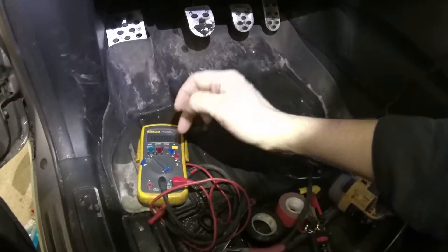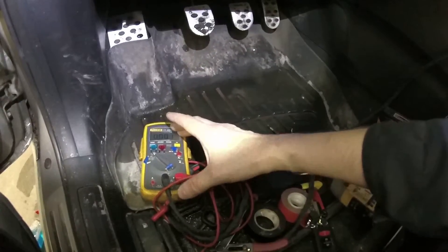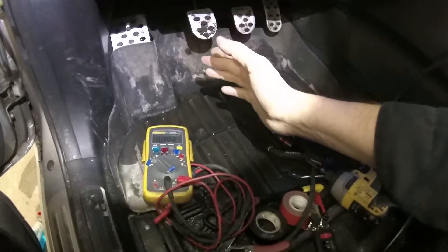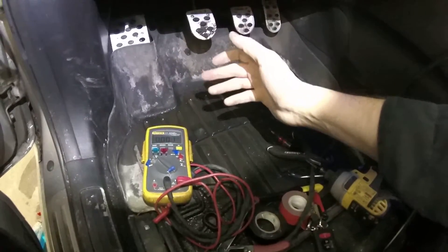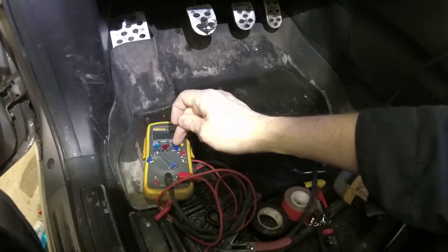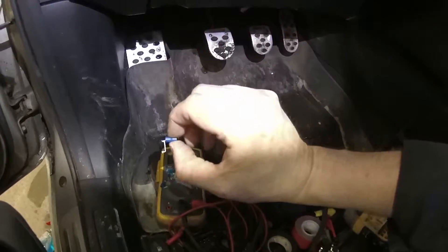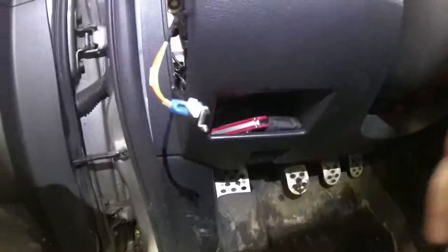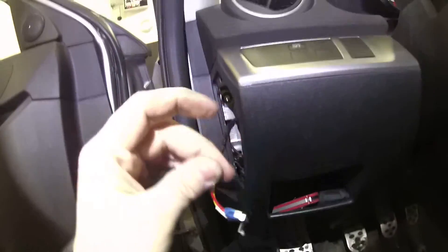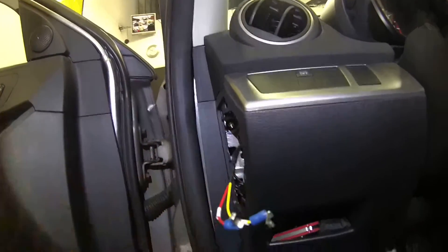What you're seeing these fuses resting on is what's known as a digital multimeter. I use this digital multimeter to determine which fuse is 12-volt constant power and which fuse is 12-volt ignition power. I've already determined that 12-volt constant is a 15-amp fuse, ignition is a 10-amp fuse, and I have used these fuse taps connected to my accessory feed, ignition feed, and my 12-volt constant feed.